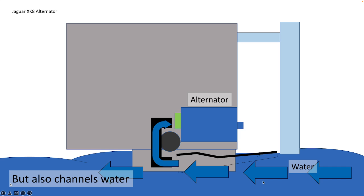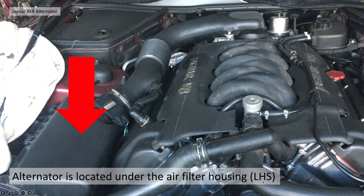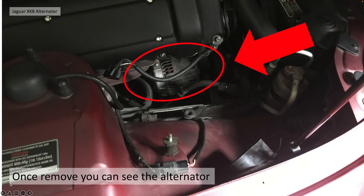So I'm thinking really two modes of failure: probably overheating if the snorkel isn't fitted correctly or you're missing your duct, but more probably water being fed into the back of the alternator if you go through a flood. Be careful — you don't want it too deep. Now, if you've got problems with your alternator, how easy is it to remove? The alternator is located directly under the air filter housing on the left-hand side of the engine. I've done a video about how to take the air filter and the air box off — I'll not cover that in this video; look at episode 36. Once you've got that air box out, you'll see clearly the alternator underneath, nestled at the side of the engine.